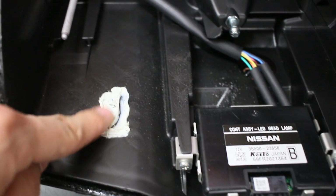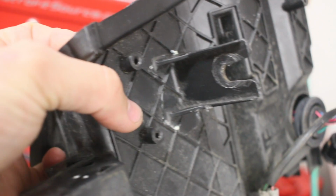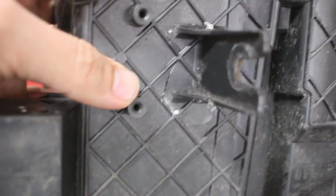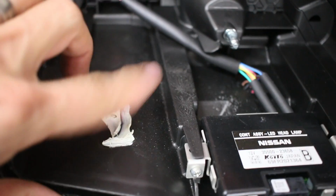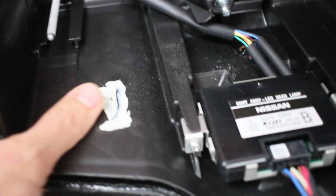They came out of this. Now look how dirty this thing is. Look at that little repair you can see coming from the bottom. And when we flip it over, you can tell what the shop did. They basically just took this busted tab, which creates a big giant hole in the light, and they just glued it on, literally Elmer's style. That's not gonna cut it. This should have been plastic welded. They didn't have it open, so they didn't have access to this.